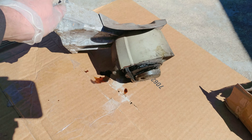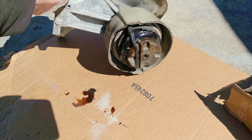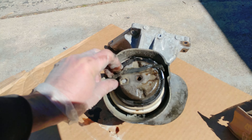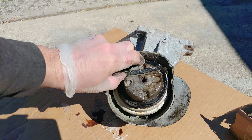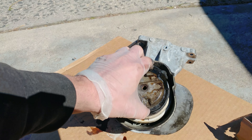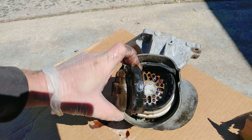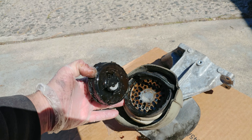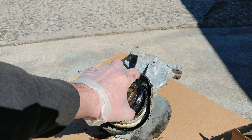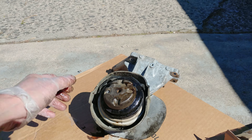This is the engine mount that's been in the car since 2003 — an 85,000 mile mount. This mount is completely done. Look at the strap — I just opened it up right in front of you. This is the mount on the passenger side, and this was the worst one. When I lifted the engine and dropped the subframe, fluid just started gushing out. Yes — this is a hydraulically filled mount.